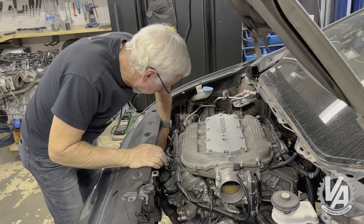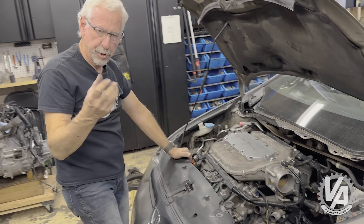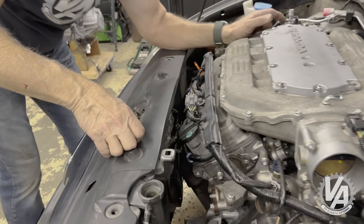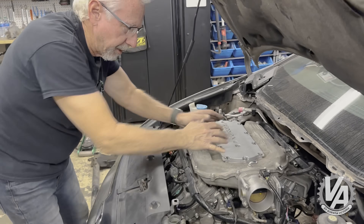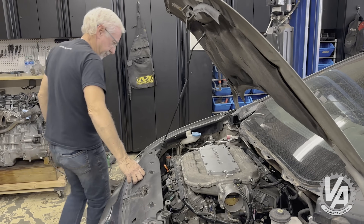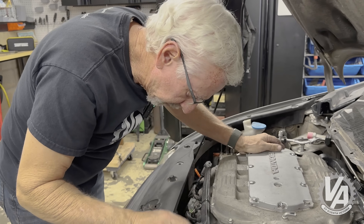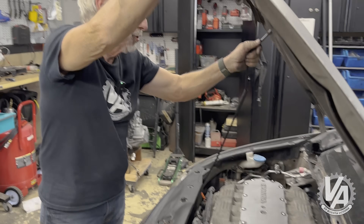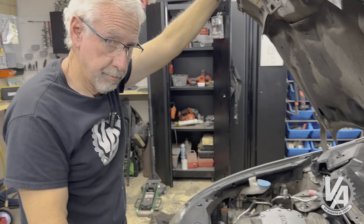It hit the manifold — that's why I wouldn't look at that, so that didn't count. I'll have to strategically reroute this harness. The alternator is hitting our condenser fan a little bit — we'll just switch to a thinner condenser fan, that'll fix that problem. You can see it making contact right down here. With that fix, this engine would be able to come forward another inch, making it a really nice fit. Lifting it up and pulling the condenser fan — a thinner fan definitely seems like there's plenty of room. Ground clearance looks stock-like, and the hood will close — yeah, it's not going to be an issue at all.